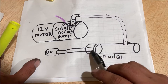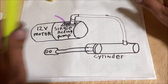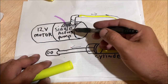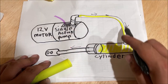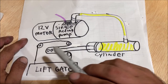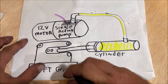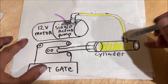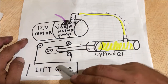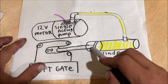Out on the truck, the hydraulic cylinder was almost fully extended. Whenever we turn that pump on, it only goes in one direction — pressurizing the line, filling this side of the cylinder with hydraulic fluid. The single-act pump can only pump in one direction and can only extend the hydraulic cylinder. This 1,600-pound liftgate is no longer in the locks — it's hovering in the air, held up by these hydraulic hoses, lines, the fluid in the cylinder, and possibly that solenoid valve. Never be under that liftgate whenever the cylinder is extended like that.